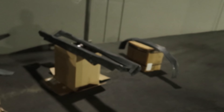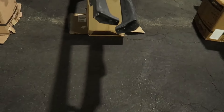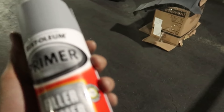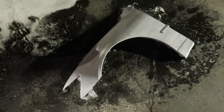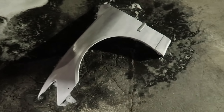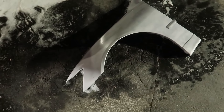This is my paint booth. This paint booth is ghetto, bro — the side skirts are held on by a barbecue sauce bottle and a little bottle of juice. Alright guys, we're just going to start the primer now. I'm not going to show too much of the painting because I'm pretty sure everyone knows the basics. Tip: if you guys are like us where you can't paint in the daytime and you prime at night and it gets all rough, just wet sand it after you prime it. Then spray your base coat, and if that's rough, sand that one too.